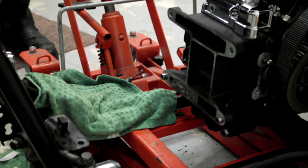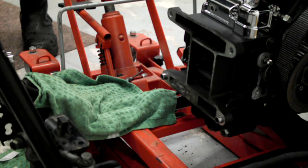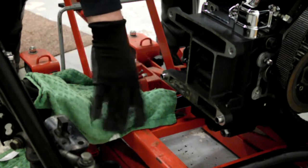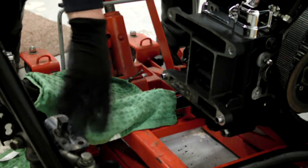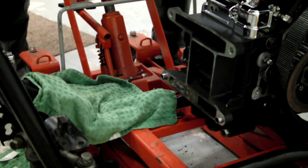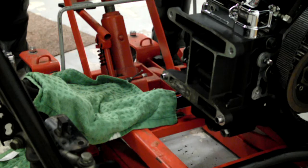The wires off the crank sensor and the stator, you'll see when I start putting it through, I've got them on the end of the sprocket shaft, and just held in place with some elastic bands. It's just so they don't waggle about and get caught when you're manoeuvring the engine in position. I've covered the brake line and the wires with just a rag. So when you lift it in, you've just got to be careful that you clear everything. Make sure you don't hit your master cylinder for your rear brake. Watch the top as you're going in to make sure you don't hit the top.